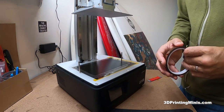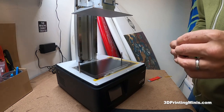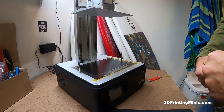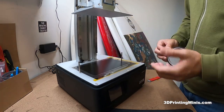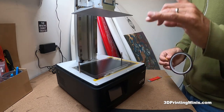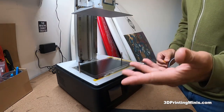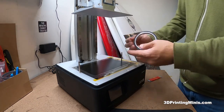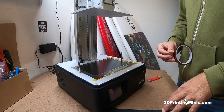While doing the second side — a commenter on Facebook and one on YouTube said, 'Hey, you're putting this matte protector over your screen — it's actually going to degrade the quality of the light coming through because it's matte and not glossy.' I say that could be the case, although the videos and articles I've read online said to use matte instead of glossy because it makes the FEP not stick to it as much, so it doesn't get suctioned and cause problems.